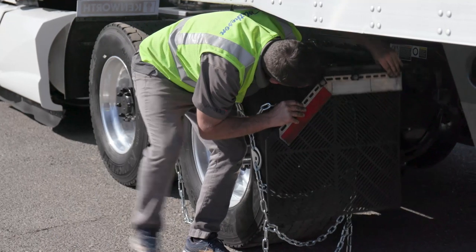The recommended speed for driving on tire chains is 25 miles per hour maximum, especially on bare pavement. Another key way to prolong the life of the product is to constantly monitor your chains while driving — keeping an eye in the rear view mirror, cracking the window a little to listen for anything that sounds off. For chain longevity, monitor wear and move tire chains from one side of the vehicle to the other after a few uses. This lets you use the opposite edge of the square link tire chain, basically doubling its life.